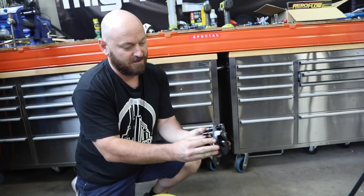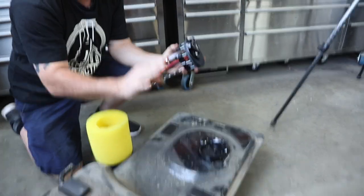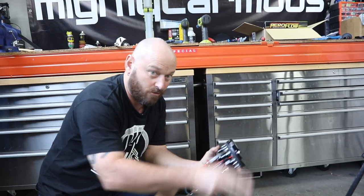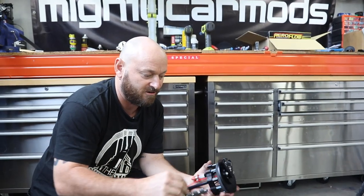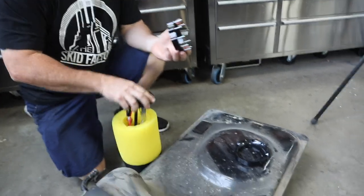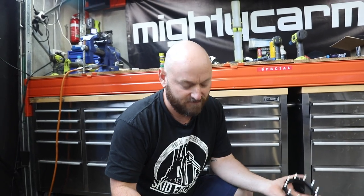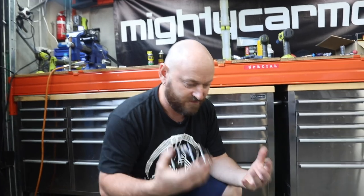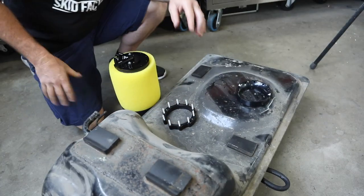Then it's got a rubber seal. We've got a nice flat surface, which is excellent, but a lot of older tanks are all corrugated, and this rubber thing actually accounts for the corrugation. So it's quite a cool idea. It saves you having all the surge tanks and all that stuff that get smelly and noisy. And in a case where you don't need five fuel pumps like this, just one in-tank pump that makes no noise is the best thing for this sort of car.